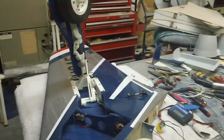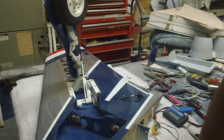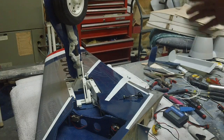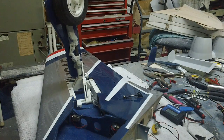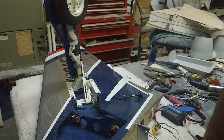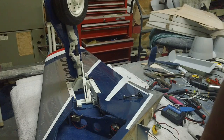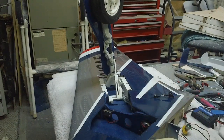You can fine tune it with this one. When it goes up, you're pretty much going to have to turn the airplane and do it from the bottom to fine tune it, because you don't want it staying on - but you want it shutting off when the gear doors are flush. You can just fine tune it with a pair of needle nose pliers, with these right here.